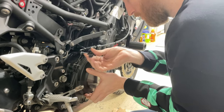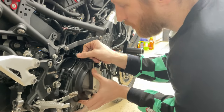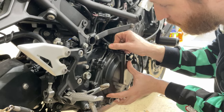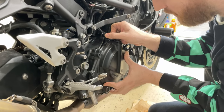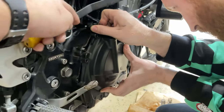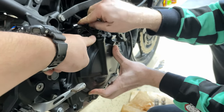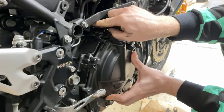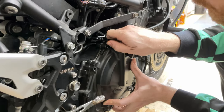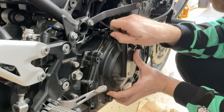Yeah. So now we're going to close her back up, and I'm going to have to put the camera down and hold it. There's a dowel pin. I need to fish the center piece. Talking about this arm right here, the actuator arm, and he needs to get that centered. Otherwise, when I put this in, there's not going to be any actuation of the clutch.